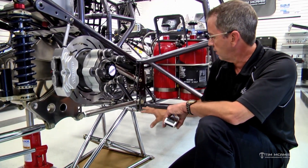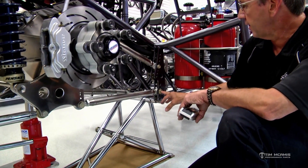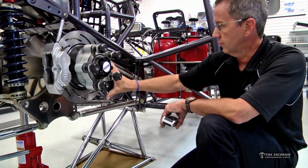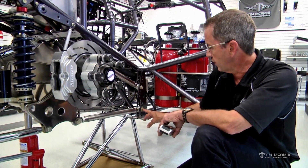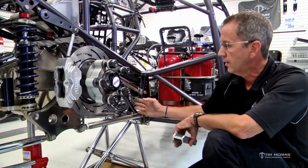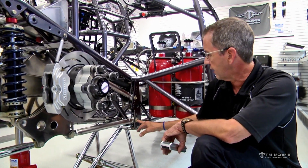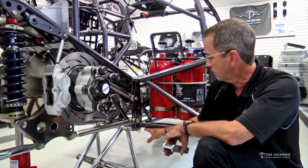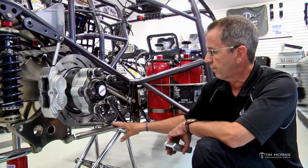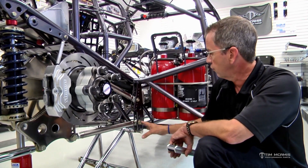Along with the spread, one of the important things to calculate this out is to know how high the bolt is off of the racetrack. One of the basics is to know the number from the front lower bolt to the ground and the back lower bolt from the ground, because you can calculate that angle easily from those numbers. A lot of times when I talk to somebody about their setup, I'll ask where their lower bolt hole is from the track surface, and they'll say they never checked that. That number should be just as important as logging the ride height — because knowing that number with the spreads lets me roughly calculate the intersect point and height.